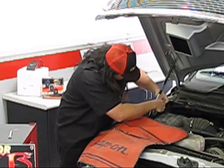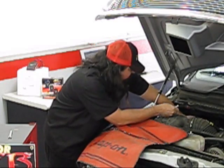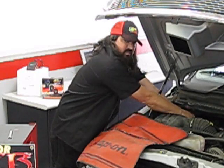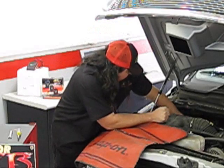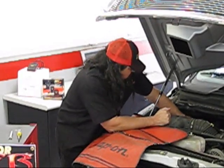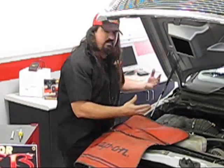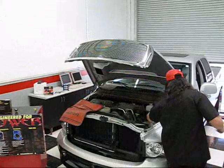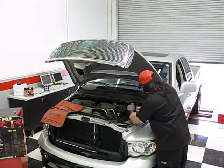Put in your bottom screw first — it's easy to line it up — then go ahead and put your top two screws back in. Once these are back in, we're going to reconnect that negative battery cable and fire it up. Tighten down the top two screws so it's held securely in the firewall. Now we need to put the harnesses back on — each one clicks back in pretty easy and they can't go in the wrong one. The one harness on the bottom will now connect to the Jet module. Remember to push those little safety latches back towards the firewall. Now the computer's back in and all secure. Use a 10mm wrench to put your battery cable back on.